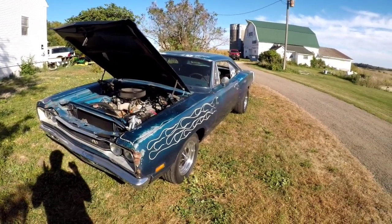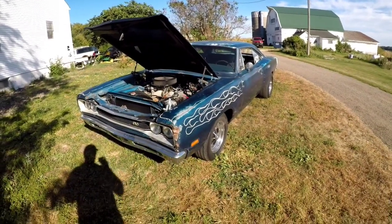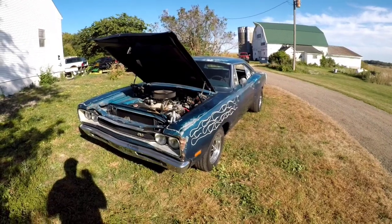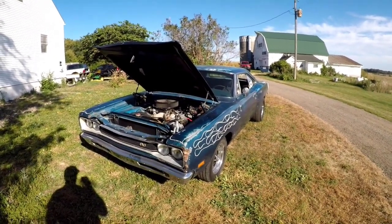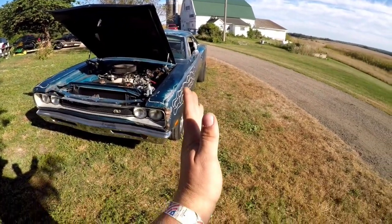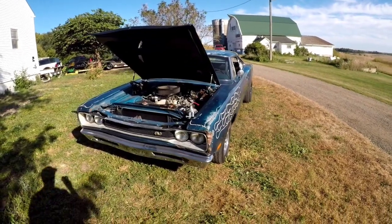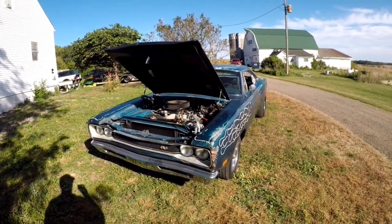We did the whole everything, but we left the lower control arms alone because we thought, okay, well, they look good and we don't really have time to get into that, so we'll do it at a later date. Well, that was a mistake because we got it all set down and this wheel was tipped in pretty significantly even after we had the adjusters turned all the way out. So we were thinking, well, what the heck is going on here?